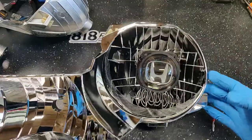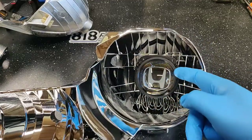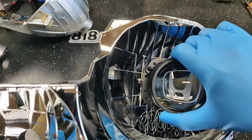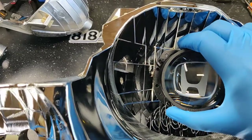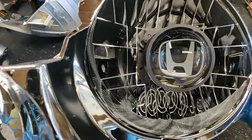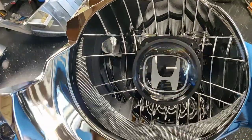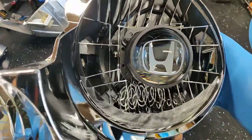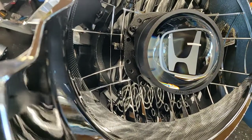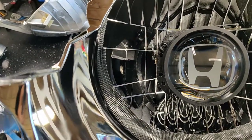Turn the projector around and make sure it is aligned perpendicular. The sides of the projector are vertical, and you can see the reflector has vertical lines — we're going to match them up until they are aligned. Give it a little rotation and you can see both sides are perfectly aligned and parallel with each other. This projector is now rotationally perfect. You can also verify it through those two upper holes — there are inner reflector lines that are visible and aligned at the same time.